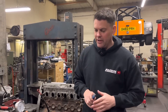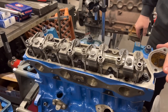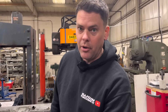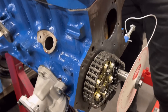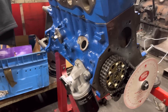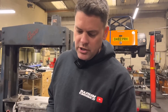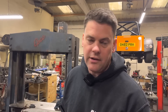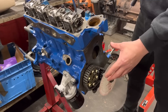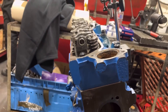Right Liam, what are we doing today? So what we're going to do today Paul is set up the vernier pulley on this cross-flow engine. This is one of the last things to do on this engine. I know I've shown you setting up vernier before on the Cosworths, but this being a push rod engine the camshaft is in the block. The advantage with that is in theory when you remove the cylinder head and put it back on it's not going to affect the timing. The cam we've got in here is a stage 4 — a 264 cam — which is a full race really, it's the second highest one really in a push rod engine. When you've got the camshaft in the block you shouldn't really need a vernier pulley, but if you're putting an uprated cam in there it may time up different to a standard one, so it's always good practice to put a vernier on there.